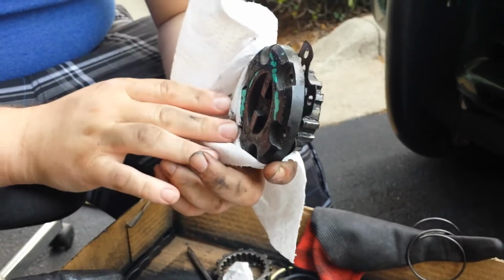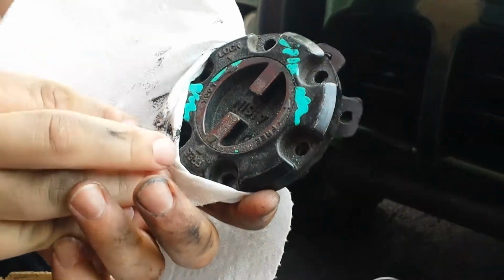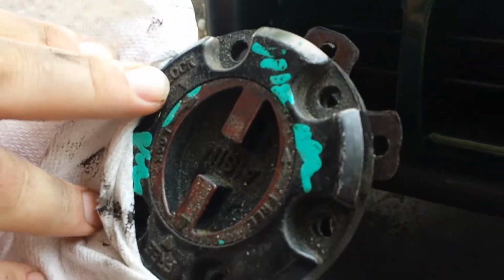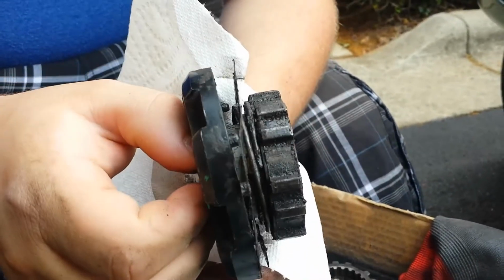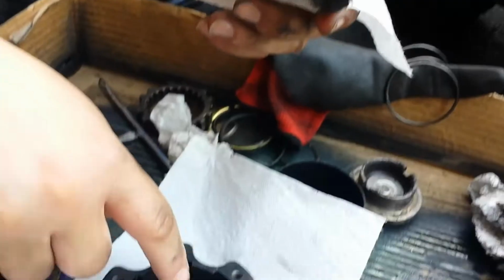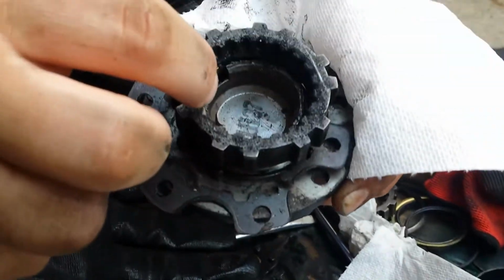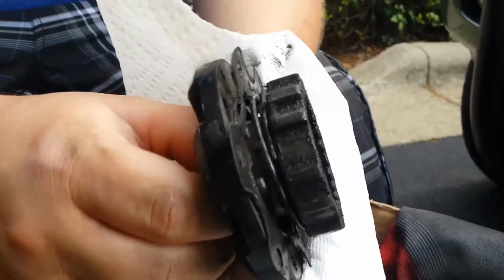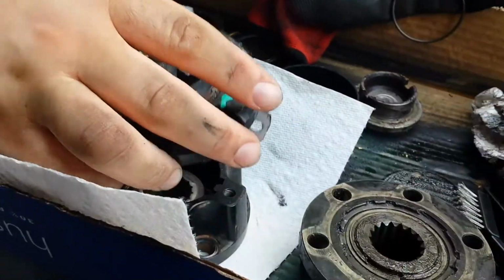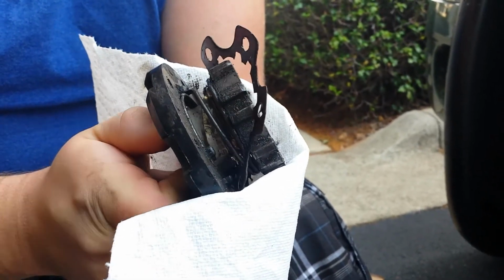Okay. All right, so I left one top piece together as my example. So this is the front of your dial. Free is unlocked. Locked is locked, of course. So, when it's free, it's all scrunched up and it's away from in here. Because, again, these gears on the inside match with these gears on the inside. And when they're together, you're locked. So it being pulled up and out of the way means it's just hovering and it's not engaged. Now when you turn, I'm going to hold the faceplate here and turn the dial, and you see it extends.